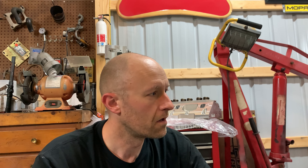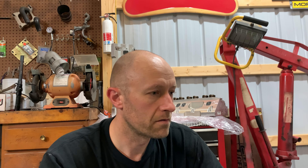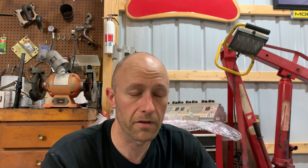So in addition to just being lighter, obviously you get a smaller combustion chamber. The 360 and 340 heads are like 70 to 72cc; the Trick Flows are 60cc. You're losing 10cc — that's quite a bit of a jump in compression, probably a whole point. Lighter weight, obviously better-flowing intake and exhaust ports, and upgraded rocker pedestals. I mean, it's all pluses.